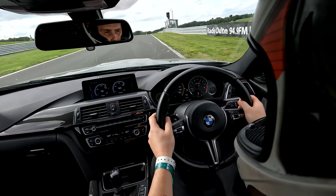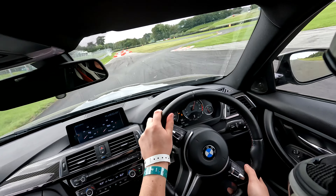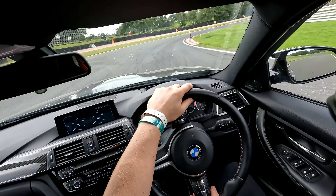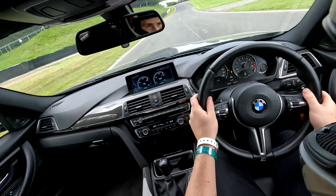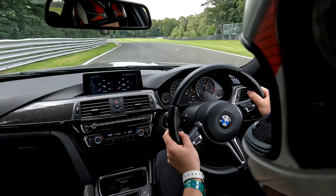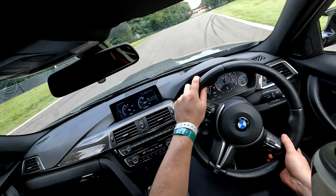On the whole, since the geometry alignment compared to Donington we've got a much sharper car to work with. There's a slight oversteer as it bumps off the kerb, but it's caught with ease — that's having good traction available and a lot more feedback through the geometry to the driver. The reason for that oversteer over the bump is the damper issue: the car is undersprung and over-damped. The soft springs cause it to lean low, and hitting a kerb at pace shocks the chassis into oversteer because the damper can't absorb it.